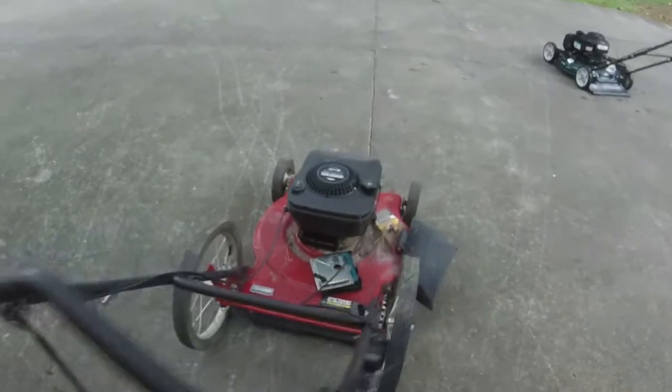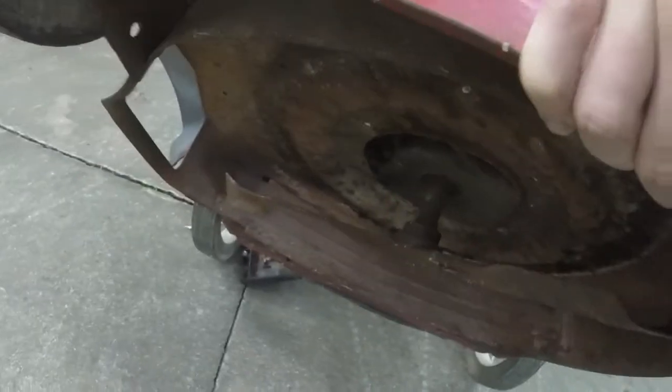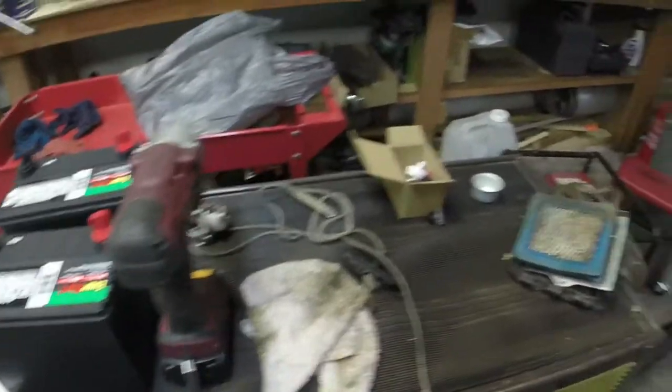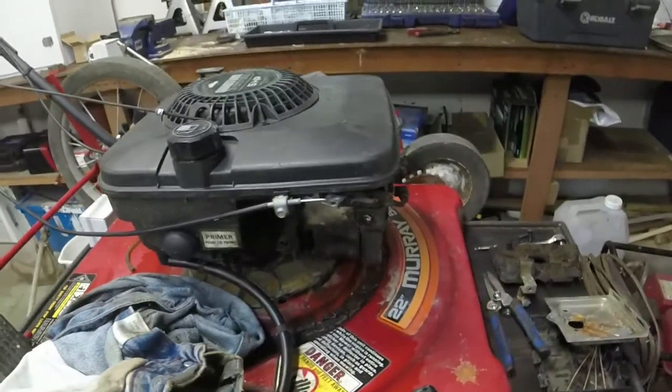So let's get to work. Most of it is just going to be putting a carburetor on it and fuel line. The oil looks like it's brand new so I'm not even going to touch it. Let's look under the mower real quick — blade I can salvage so I'm not worried about that. It's got one of the universal blades on it though, so I might pick that off and put one on that only has a little hole in the middle. We'll get this thing up and go ahead and change the carburetor out on it — get it back functional.